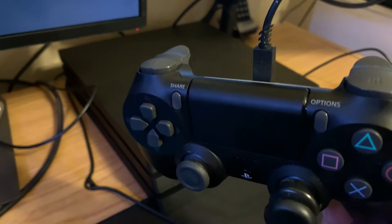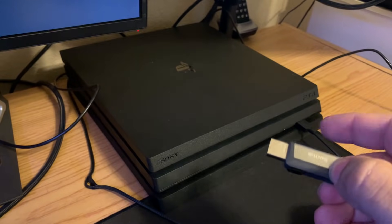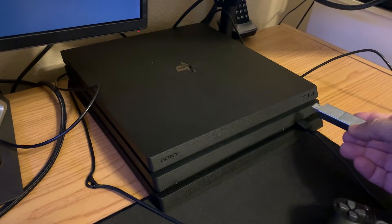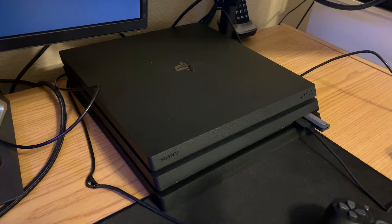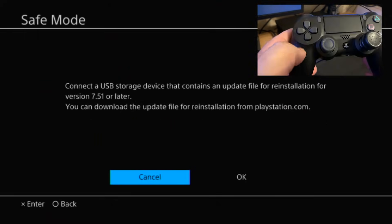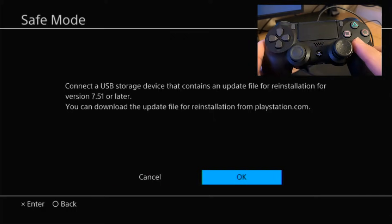Make sure your PS4 controller is connected with the USB cable to your PS4, then plug in your USB flash drive. If your flash drive is too thick or not compatible, there's a link in the description below to a compatible USB flash drive that works with the PS4. Make sure the flash drive is all the way in, then hit the power button to turn on your PS4. On the screen press the PS button, then use the d-pad — not the analog stick — to go right to OK and press the X button. This will read the update file from your flash drive and load the PS4 system software.